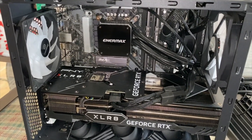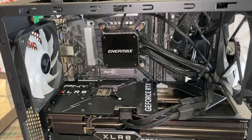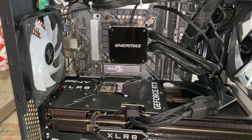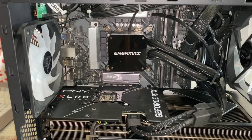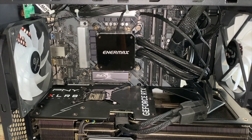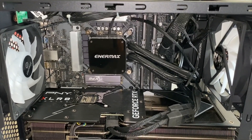This video shows how to change the CPU in your computer. The first thing you're going to do is remove the heat sink off of the CPU. In this case mine is a cooling block because I have liquid cooling, so you can see those four screws around the perimeter of that. I'm going to remove those and pull the cooling block off, which exposes the CPU. Then I'll show you how it can be removed, replaced, and how to put it back together.